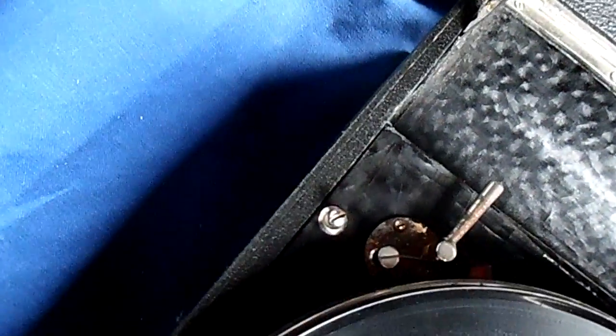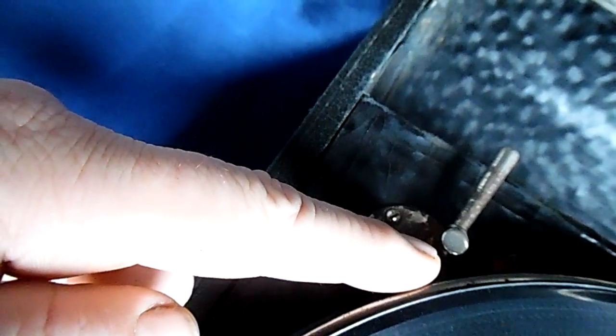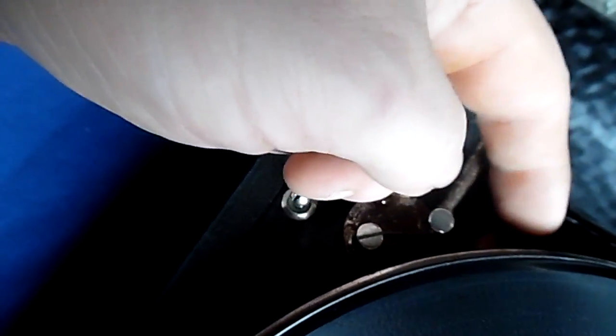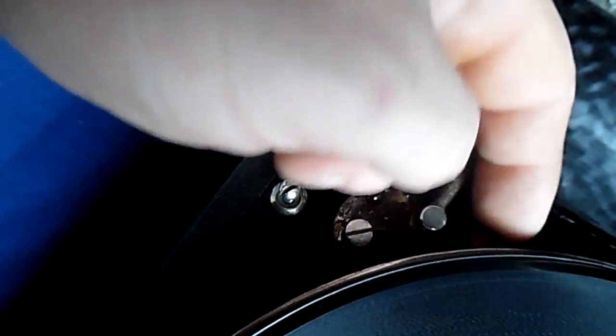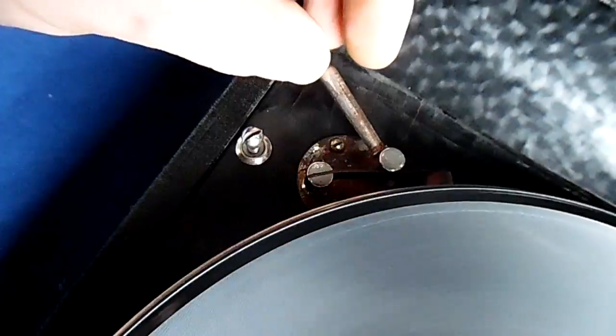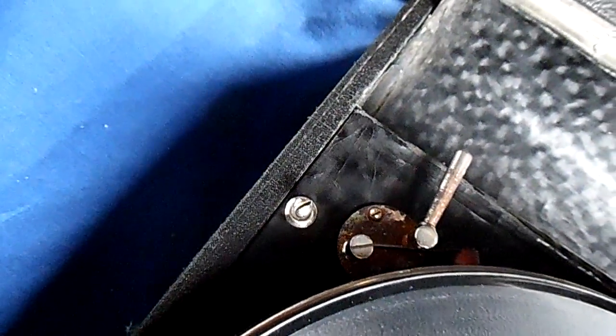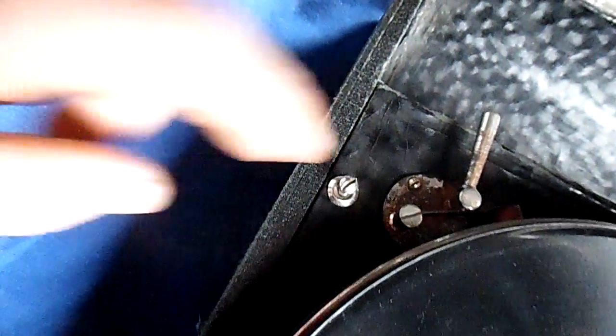That's a Sheffield-type brake, and these are really crappy — it's one of the few crappy things on this machine. What you basically have is a hub here which holds a spring metal piece with a piece of hardened vulcanized rubber on it. To release it you put it in neutral; to brake it you go all the way over. The spring metal in a lot of cases is bent and not in good position, and in a lot of cases this doesn't work. Also the hub tends to break loose, as well as the engaging mechanism of the brake.